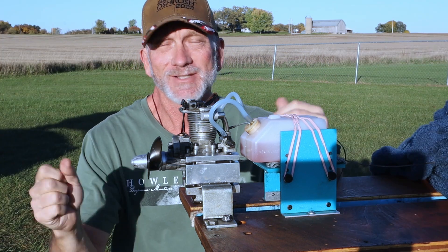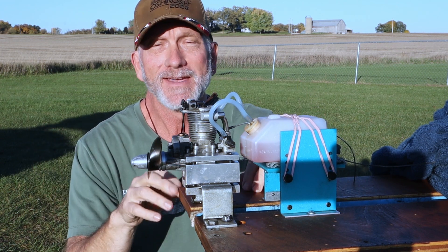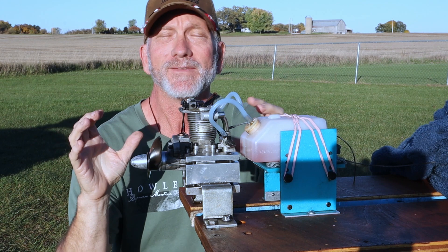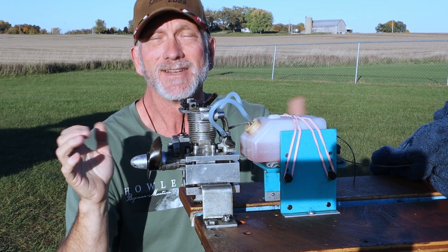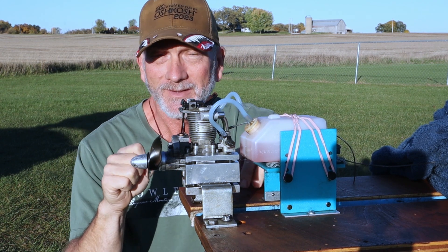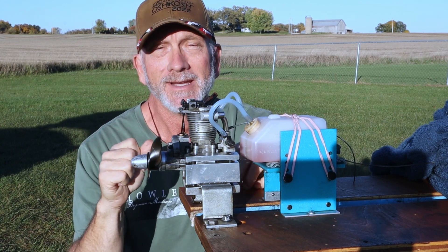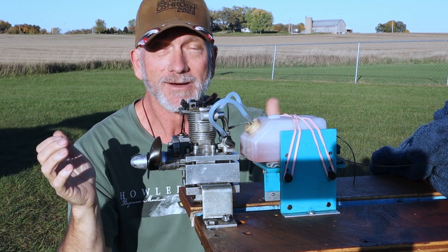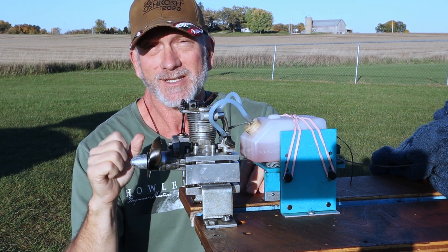It's about an hour before sunset, so I don't have a whole lot of time. The subject of tonight's video is this Saito FA-45 engine that was the subject of two videos with bad bearings. What I have done with this engine is, just for the hell of it, I decided to invest the $7 in bearings. I completely disassembled this engine, replaced the bearings, and I didn't do anything else to it — I didn't clean it, I didn't do anything. I just replaced the bearings and put it all back together. Now we're going to see if it runs any better, if it sounds any better — it'll sound better, guaranteed. But I want to see if I get any better high-speed RPM, because I believe that this engine is just worn out.